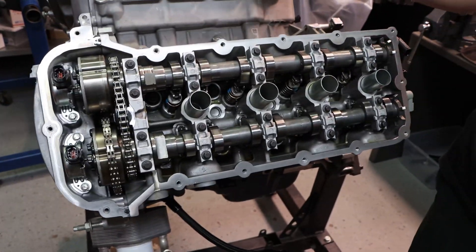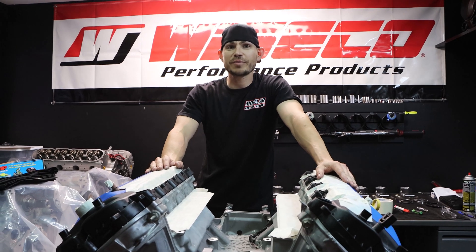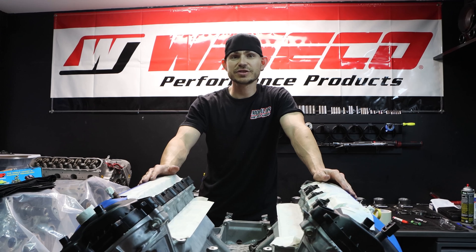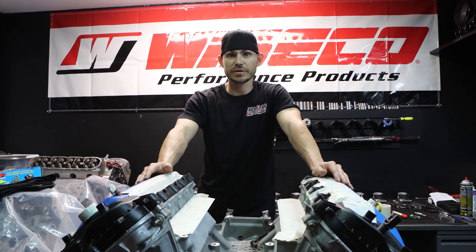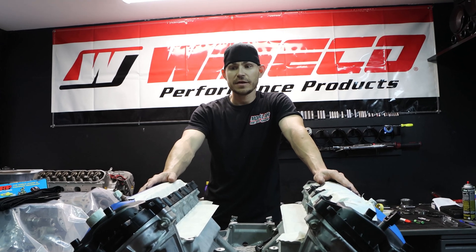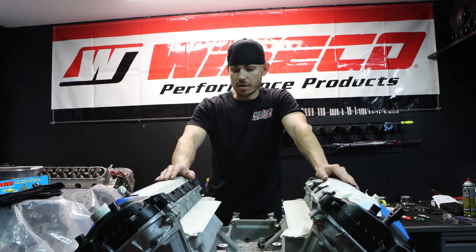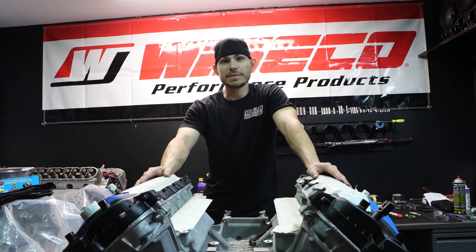Now before anything has happened, all of our tensioners and everything have got oil pressure in them, and that's exactly what we want. That's going to wrap it up. This is the correct way to prime an engine — the delivery method may be a little ghetto, but it's easy to do at home and it is the proper way. Priming the engine from an external oil pressure source is always best — not off the starter. Regardless if you take the spark plugs out, the starter is not going to turn the crankshaft fast enough to produce good oil pressure. Keep pumping until you can hear or see the oil coming up through the valve covers. If you don't have extra noise causing an issue, you can do it all just off the sound. If anybody has any questions, please put them in the comments below. If you like the content, like and subscribe.